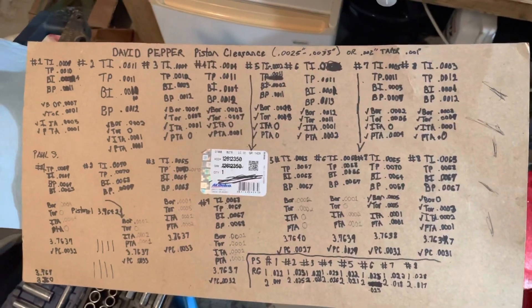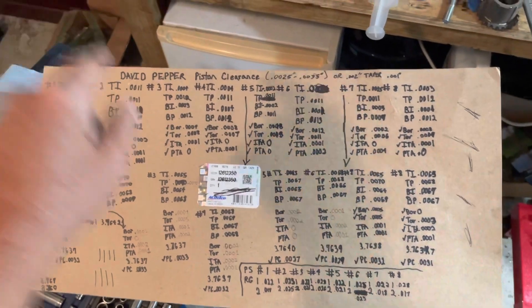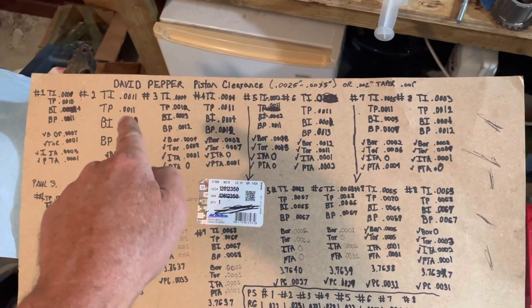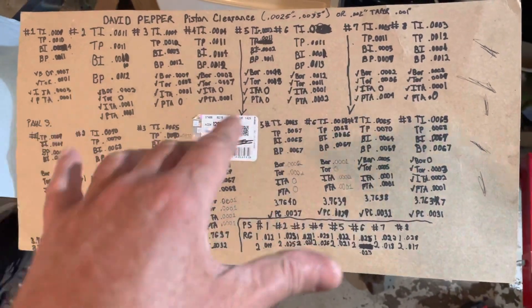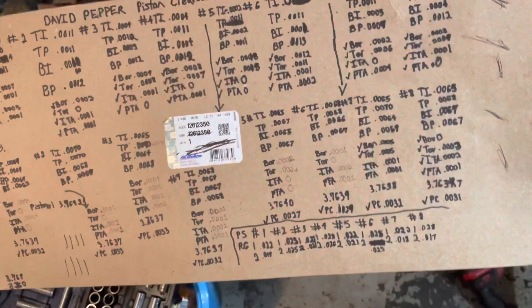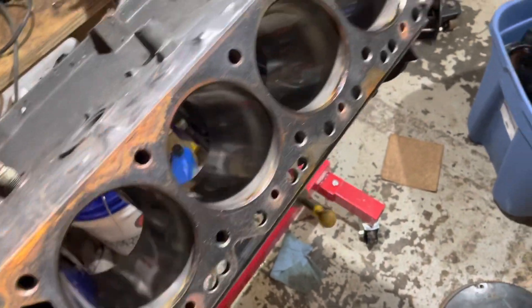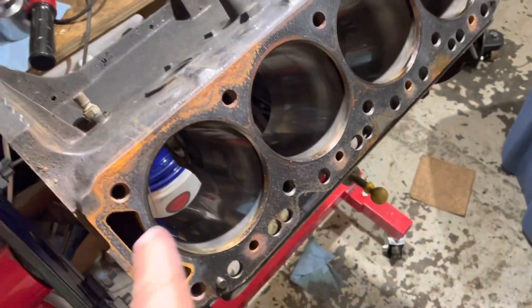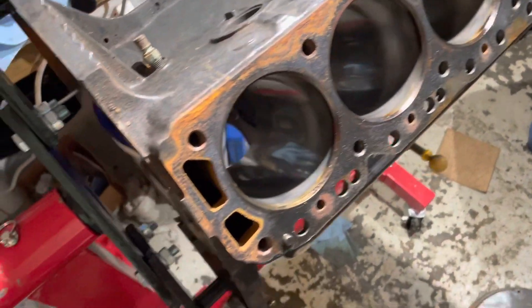Here's a piece of cardboard where I wrote down all the measurements on a V8 — actually two V8 engines. I had four measurements per cylinder, with my son writing them down and doing calculations while I moved from cylinder to cylinder. With the dial bore gauge I can do this fairly quickly. On a used engine, do your top perpendicular first on all cylinders and that'll probably tell you whether the engine can be reused without machining.